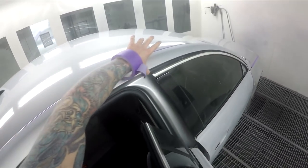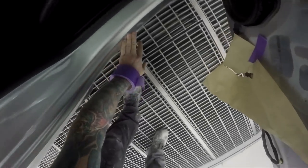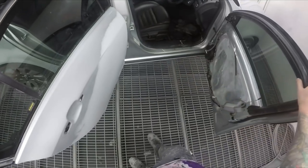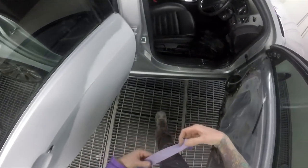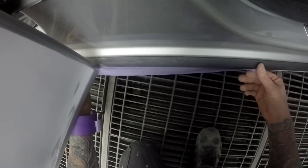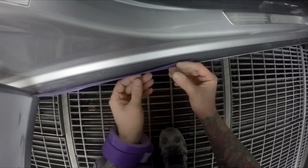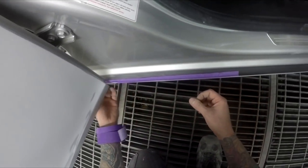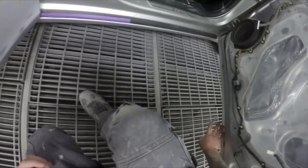Always mask your rear door first — you have to do that, or else you won't be able to mask the front edges of the rear door properly if you mask the front door first and then shut it. I have to paint the seal panel on this car because it's all connected to that quarter panel, so I'll just leave that rubber on. I'll get this tape right up underneath there and that should be fine — it'll also serve as a little bit of a barrier to stop any overspray, and it will seal up onto here.